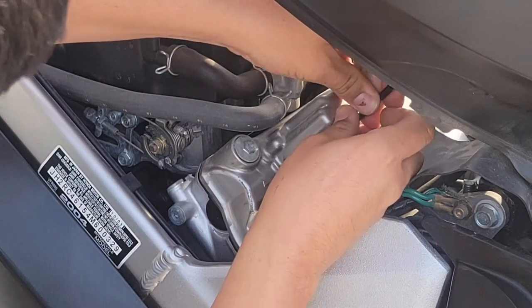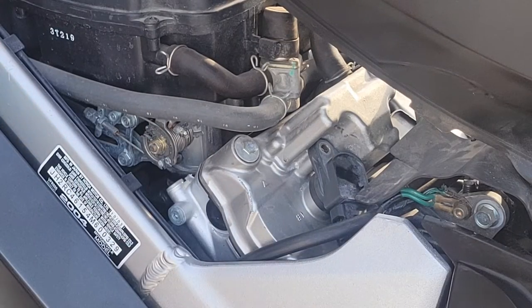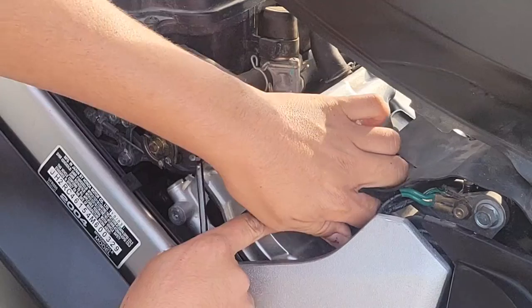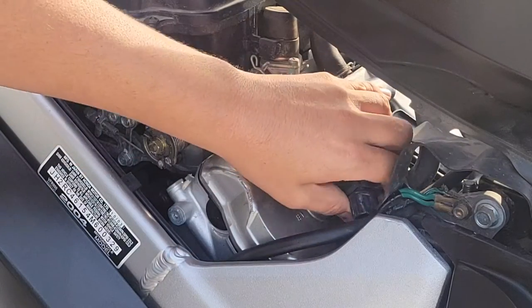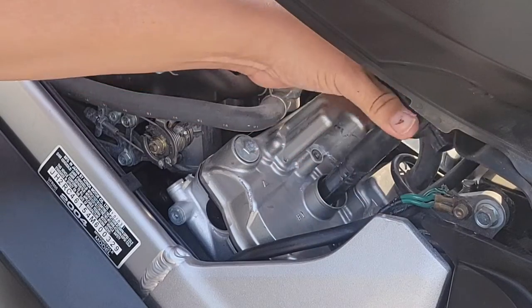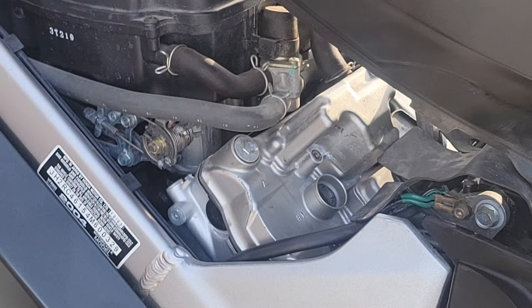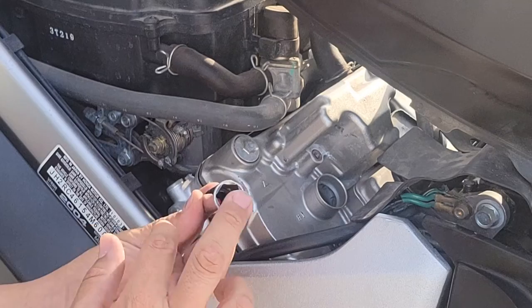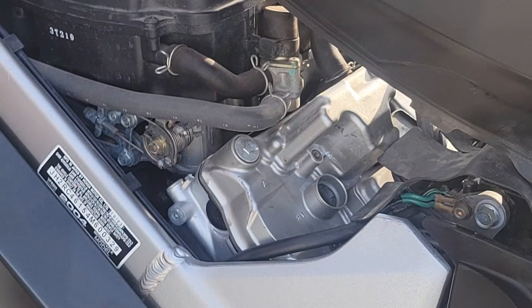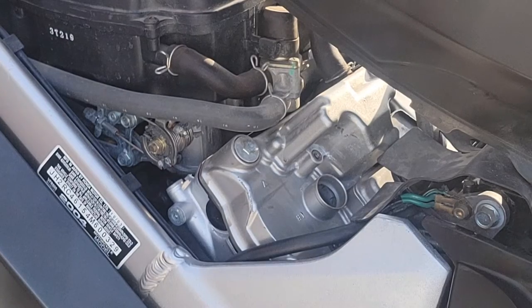This is not too bad to loosen up. This is a simple procedure — don't pay hundreds of dollars to have someone do this. This one you can do by hand or grab a screwdriver — it's just a little clip, you squish it and pull it out. Got the bolt out, wiggle it through, and now we have the coil pack. After that, we're going to need a 5/8 socket — this one from my set has a little rubber grommet inside, which is great because it lets you pull the spark plug out without struggling.